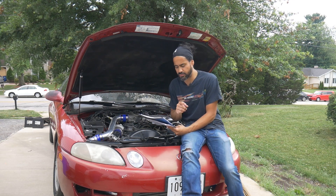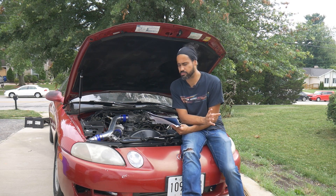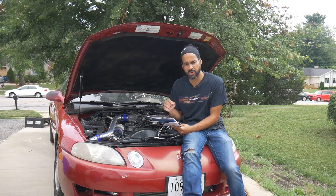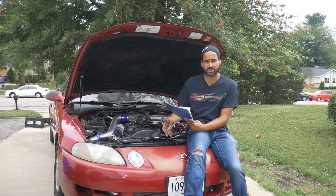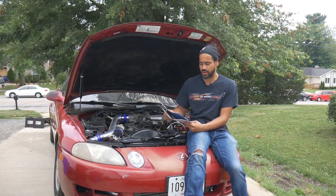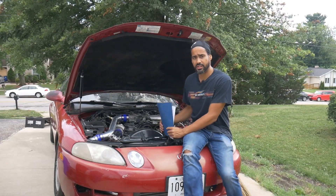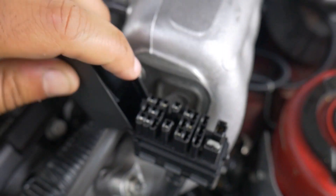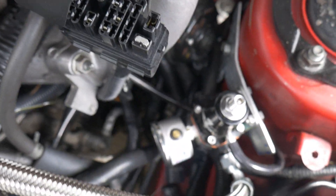The last thing is the fuel pump. I ended up using 72B, which is labeled as LS2, and everything is working perfectly fine. As far as ground, 28B is going to be on your diagnostic port. I just ran all of my sensors to 28B on the diagnostic port and everything is working there perfectly fine.